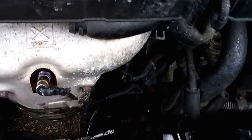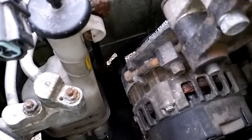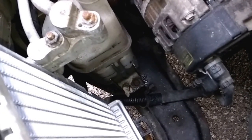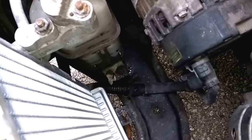Now I'm going to put these bottom bolts in, get the fans back in, hook up the upper hose, put the brackets back on — pretty much in the reverse order of how I took it apart. I'm also going to take advantage of having the fans out — unless you take off the power steering pump and alternator, you're not going to get that overflow reservoir tank out of there. Now that I have nice clear access to the side, this is the perfect time to pull that sucker out and clean it. During the timing belt job I wanted to do that but had already put everything back on. So now I'll pull it out and clean it.